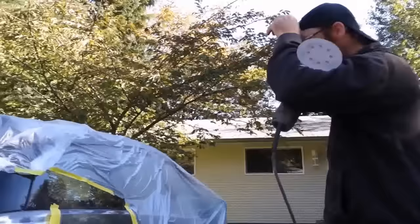Okay, so we're gonna prime this again. Yep, give it a primer, just to make sure it's all uniform and even when I paint it. Okay, so this is coat number, what is this? Three. So would that be pretty much it then? Three coats? Yeah. Sand that down. Okay, so we're sanding down the last coat of primer now. 800 grit. Okay, so the bumper's been sanded down with 800 grit and then 1500 on top of that. And we're about ready to paint again.